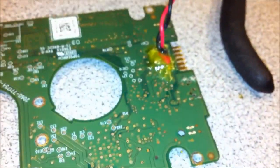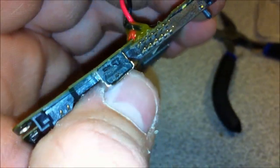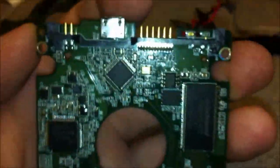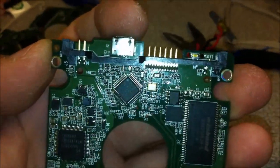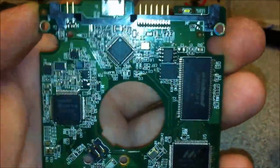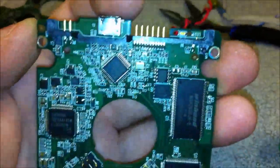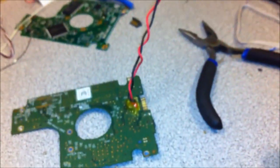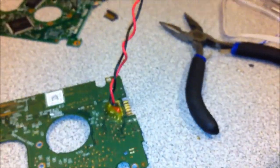Basically those were the power, now this is going to be the SATA connections here. I have done a drive along these lines before, just not quite with the port built in like this. And man, is that chewed up. Again, I could have just soldered off that and gotten another jack, but if I do that and transfer all the data through USB, he doesn't want this hard drive anymore - he wants to switch to a new style hard drive. So just repairing the jack would mean transferring 450 gigabytes through USB 2, which anyone that knows anything about computers knows would be like a day and a half. Going through SATA, 450 gigabytes should take about four hours on average.